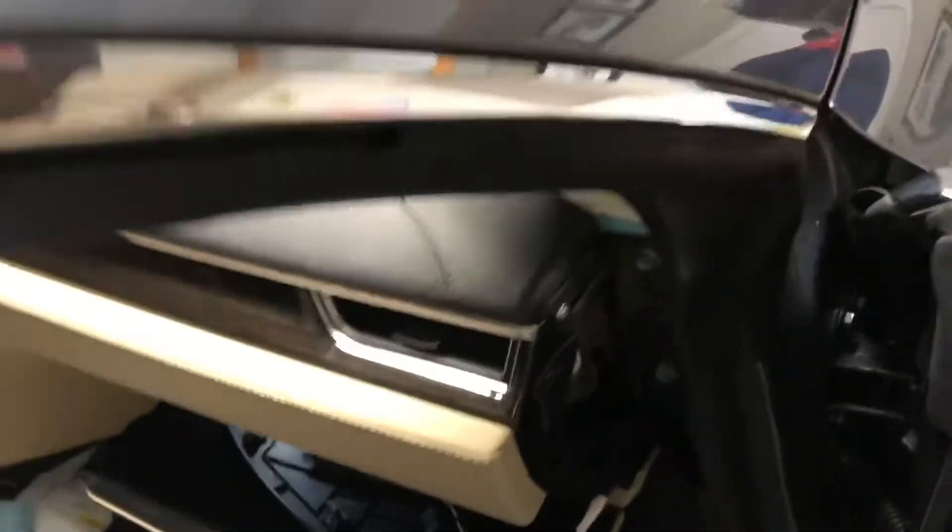More interestingly, here's where we get to see what the video can pick up. If you look under here, you can see the back side of the tweeter. There's a black connector which appears to have nothing on it. More interestingly than that — I'm going to have to go around to the other side to show you — I think when they were replacing the headliner the last time, they forgot to plug it back in.